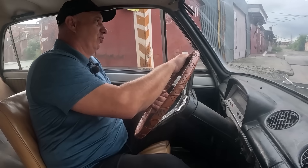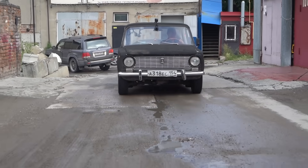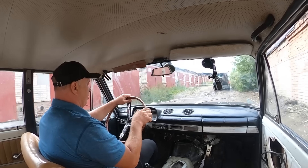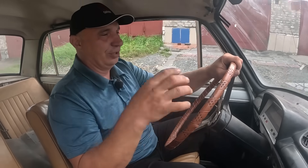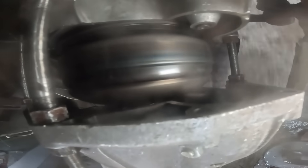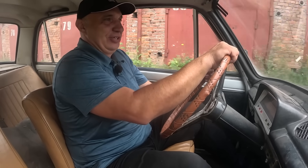Second just slipped right in. I've got it in second because we're going to go up a slight incline. Give it some gas and here we go. The engine is turning at higher revs, the car is moving, and you can feel that the torque isn't being transferred directly. Assuming you got a manual, this feels very much like you got a slipping clutch. But we all realize that we're not running a clutch — we have replaced it with a torque converter. But hey, the car does drive.